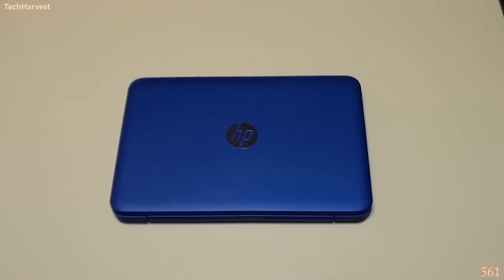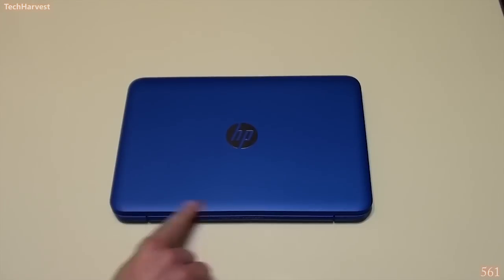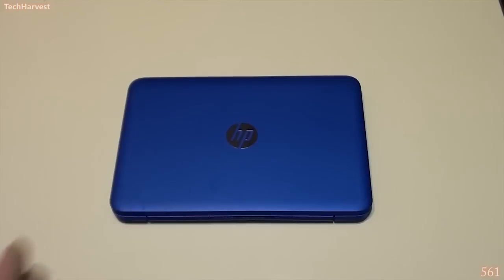The HP Stream 11 is a compact device — 8.1 by 11.81 inches, 0.76 inches thick (20.57 by 30 centimeters, 1.98 centimeters thick for those outside the US), and it weighs 2.8 pounds or 1.27 kilograms. It has an Intel Celeron N2840 running at 2.16 gigahertz per core — a dual-core device — with 2 gigabytes of DDR3 SDRAM, a 32-gigabyte eMMC drive (essentially an SSD you'd typically find in a tablet), running Windows 8.1 with Bing, and 802.11 B/G/N Wi-Fi plus Bluetooth.